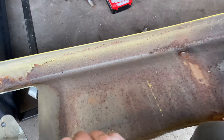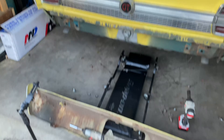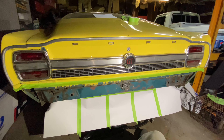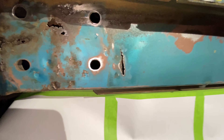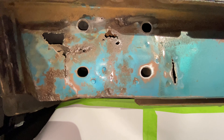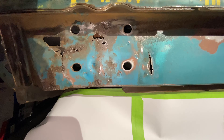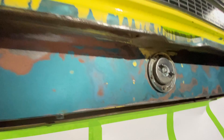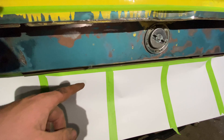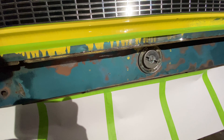I went ahead and took the license plate holder off — they're 7/16ths nuts on the back side. You just pull them off and the license plate holder comes off. I'm just gonna pull this light out here — that's 5/16ths for those. I'll use my ratchet and socket and pull these off. Now that's out of the way. I'm gonna clean all this up, give it a coat of paint, and do whatever I need to do before I put it back together. Now the bumper is free — we can take this bumper and throw it away. We don't need the bolts, don't need any of the stuff for it because it all comes new.